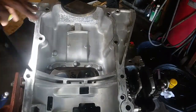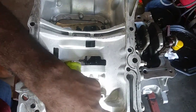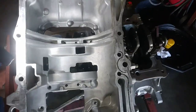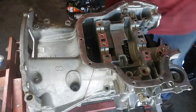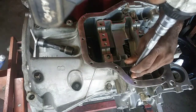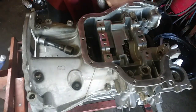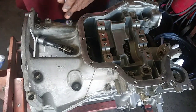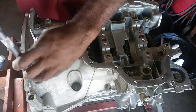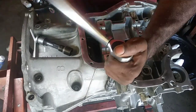So here on the sub-assembly, I'm going to put sealant from the corner here all the way down to the bottom corner. Same on the opposite side. Just glue it all the way through these channels, all the way up to here. The glue doesn't have to go on the outside here, just the inside. Torquing all my bolts down at 20 foot-pounds.